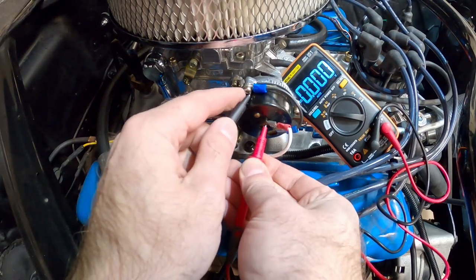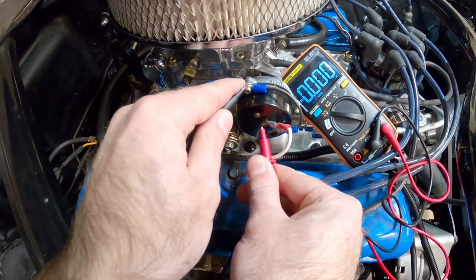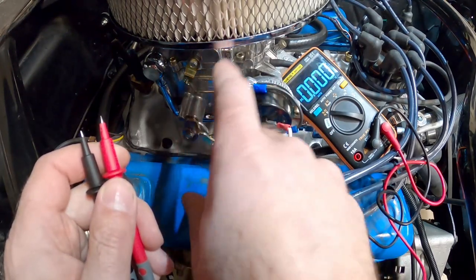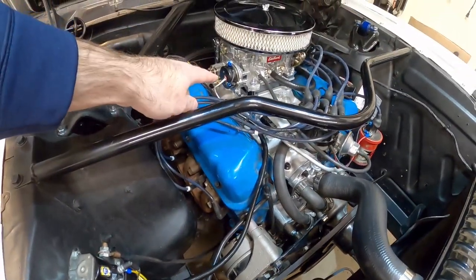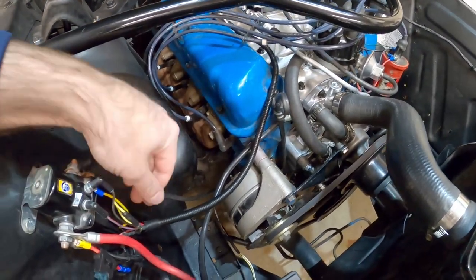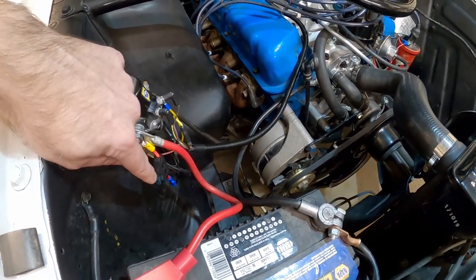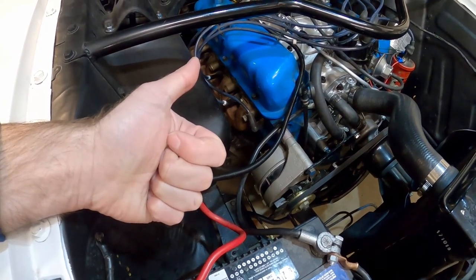With the key off, let's check the terminals — no voltage, that's what we want. Now let's turn the key on. With the key on — there we go, 12.66 volts. That'll work; that's enough to activate the coil. As the coil gets electricity, it'll heat up and spin the actuator to move the choke door open on the carburetor. Alright guys, that's how you put a relay in to actuate the electronic choke on your carburetor. Now you can go back and clean up the wiring, add some more loom, and make it look professional and tucked away. Don't forget to put a fuse inline, and you're set to go. If you liked the video, give me a thumbs up, and if you subscribe I appreciate it — we'll see you in the next one.